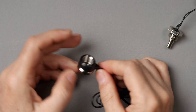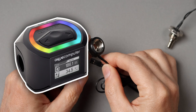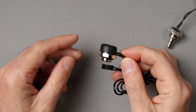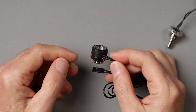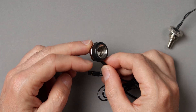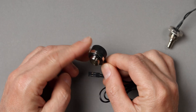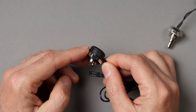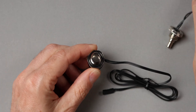You can also get other devices that have a temperature sensor integrated, like a water flow meter or a pump. In that case they typically have a USB interface and are connected to the motherboard. The disadvantage of not having a temperature sensor connected directly to the controller is that there can be some latency before the measurements reach the controller, and that can make a target temperature controller a little unstable. You are also dependent on some software or service that has to be running on the computer for the controller to retrieve the readings.